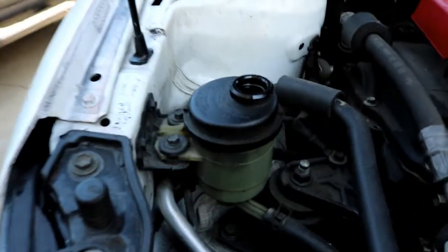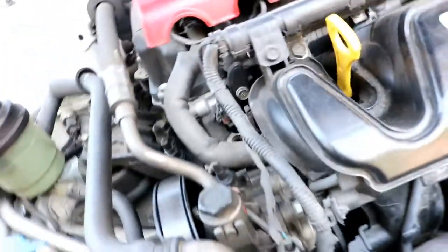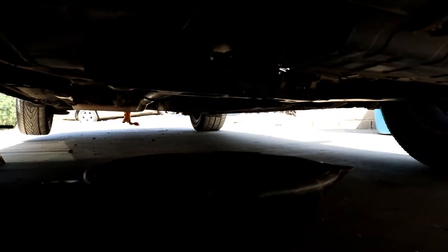So this is the power steering pump of his car. I uncovered it, so we're going to follow down the lines over there somewhere and then just go under, drain it out into this pan, turn the wheels left and right — that's how everything gets out.